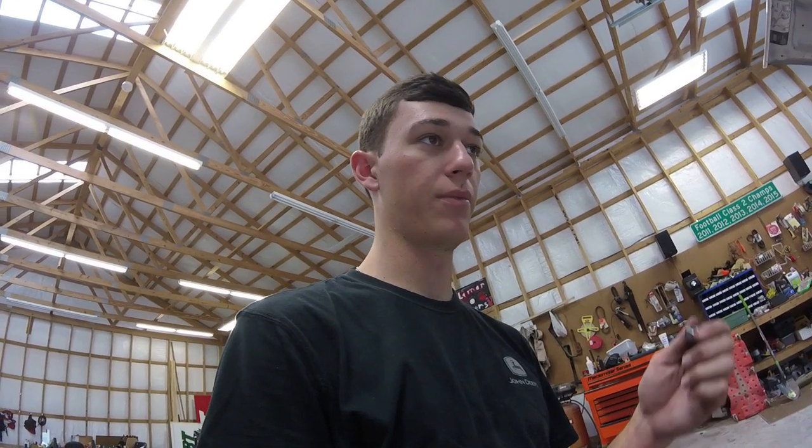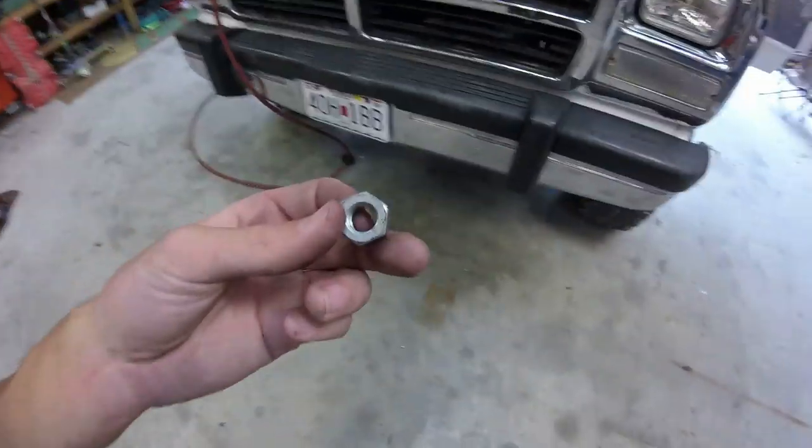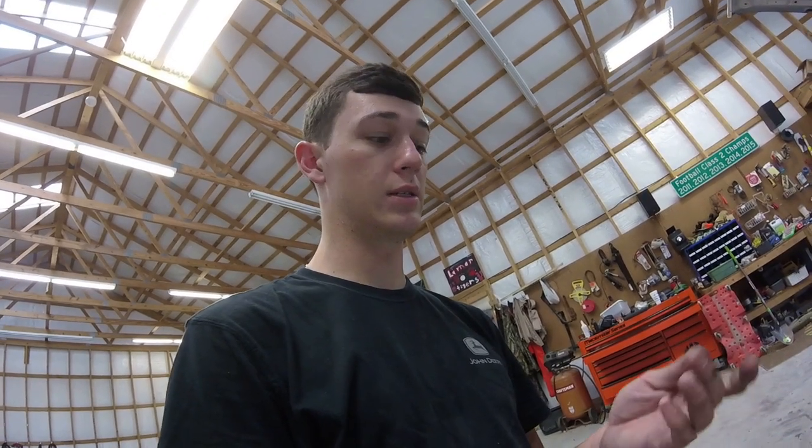I've had these injectors out multiple times before. If those things have been in there and are solid, really stuck in there from when the truck was new, you may have to buy an injector puller or figure out something like that. But for me, this is all I need. Mine had 5x12s in it before this, and this is still all I did. I just popped it pretty hard with the claw end of a hammer. I'll show you guys how I do it.